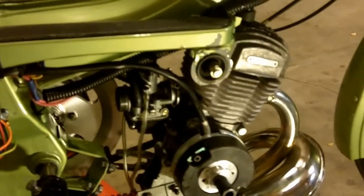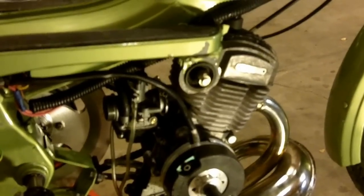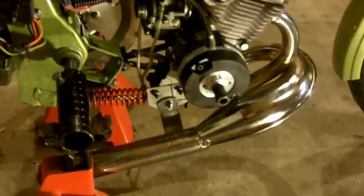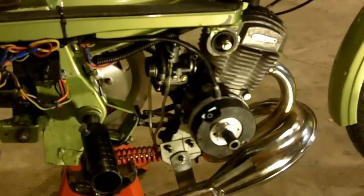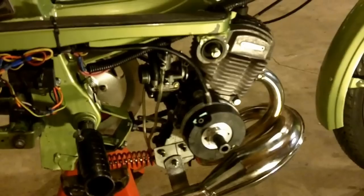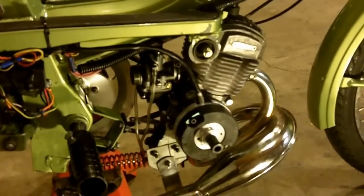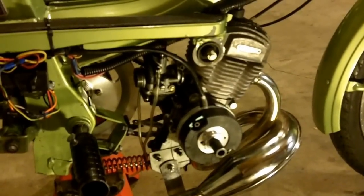But I'm still seeing it. He also noted that one of my mounts was torn, so I replaced the mounts with these — everything should be good now. I even bought this cheap SIM pipe just in case the way my Doppler pipe was mounted was vibrating too much and causing the fuel to spill out. I threw an SHA on there — it doesn't have the overflow spigots, but it still had gas draining out of wherever it could when I revved it. So I don't know. I'm going to start it up and let you guys see what I'm seeing.